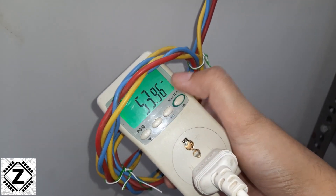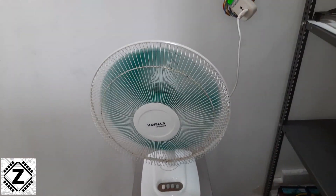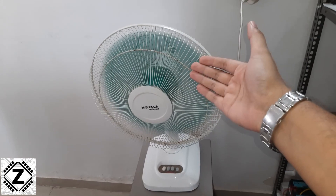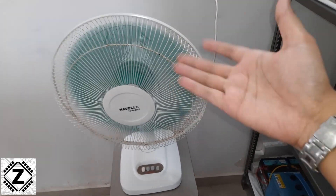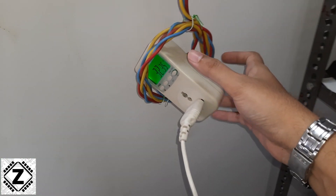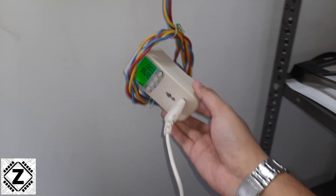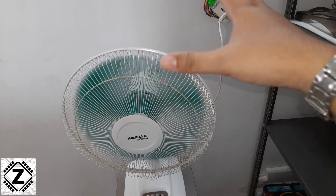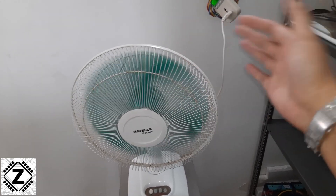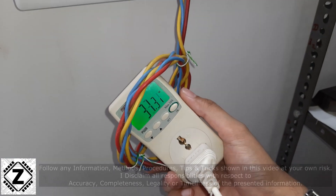Let's try an even lower speed — this is speed number 3 on the dimmer. The best part of this setup is that it makes the fan really silent. I'm really annoyed with the loud buzz that these kinds of fans make, but now it's running very nicely and is very well tolerable even while recording or making videos. The power consumption here is really frugal — just 30 to 32 watts. In fact, the latest BLDC fans run on this kind of wattage. So if you have an old fan that you want to use but want power savings similar to a BLDC fan, maybe you can try this particular trick.